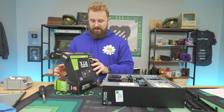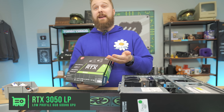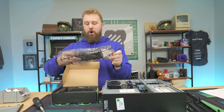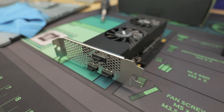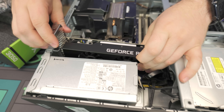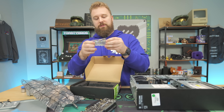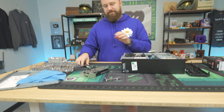The beauty of the RTX 3050 6GB is it comes in low profile now. Yes, it is a bit slower than the 3050 8GB, but the price point at $179 and the fact that it's low profile with no external power requirement makes it really awesome for these upgrade options — honestly the best new option right now. Opening it up — oh my goodness, look at that. That is the full-size bracket, not the low profile bracket. Also worth pointing out: if you're trying to use one of these in a Dell, the card is too thick and would suffocate right up against the PCIe slot. That is the beauty of these HP Z2 systems. Looking at the low profile bracket — this is like a dual-slot card taking us back to the GTX 1650 low profile era. Glad we're here again.